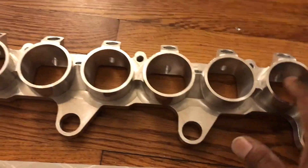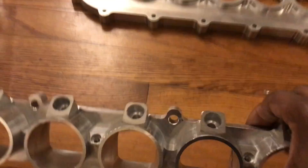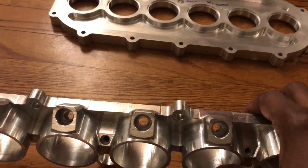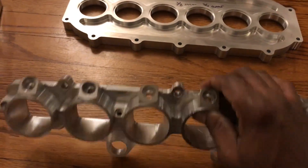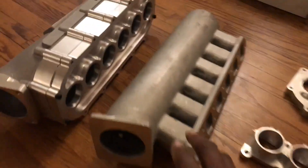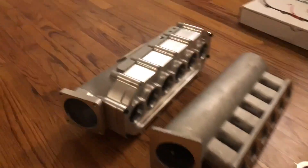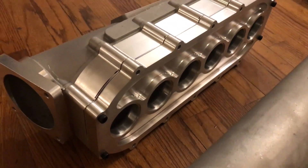This part right here is our adaptive plate that will be bolting up to the cylinder head. This engine is going to be running 12 injectors — the original six plus an additional six that go right into these ports. This design is going to be extremely nice. For reference, this is the 3.2 intake manifold — and back here in the background, this custom setup is looking sweet.